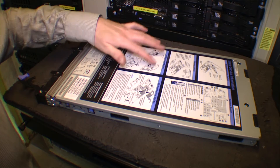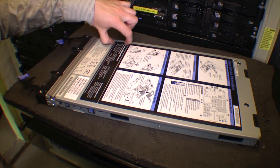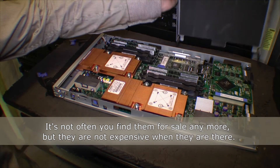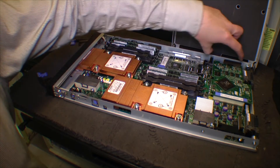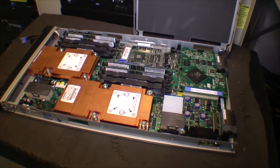These would be extremely cheap on eBay as well. Here we have the expansion card — an IO expansion card — and this one is an HBA. This server has no hard drive; it has only one bay for a hard drive, but it's actually configured to boot on this card. So it will be presented an iSCSI disc somewhere — like an iSCSI SAN — and it would be possible to present the blade server with a boot disc up there. This card would be able to do that.